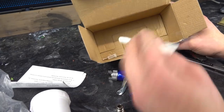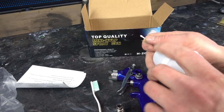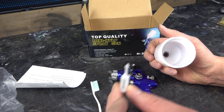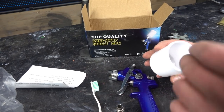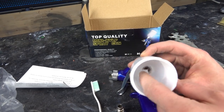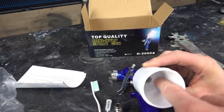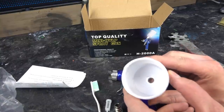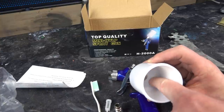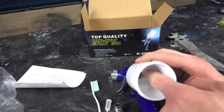Also in the box is a brush to clean the spray gun — it can be mounted inside the cup, but it's only for one-time use. Now check this: there are chips inside the cup. I have to remove them later. Imagine a chip gets loosened by solvent and runs through the gun onto your freshly painted parts — that would be horrible. So I have to tune the cup and seal the nipple.